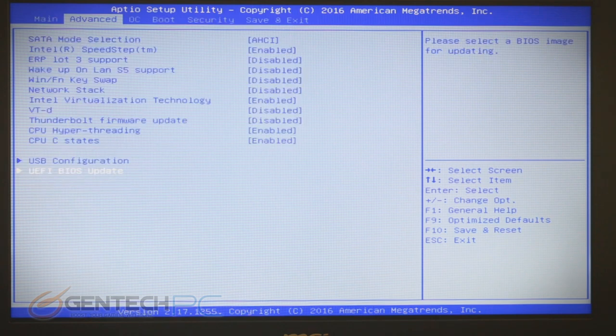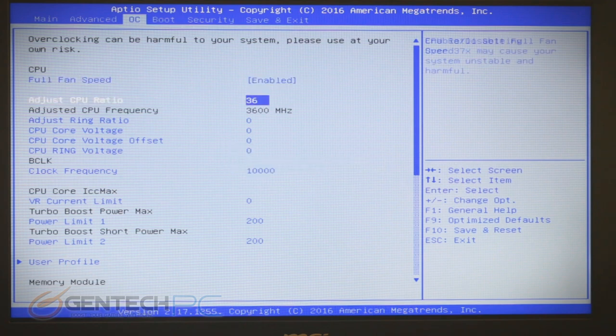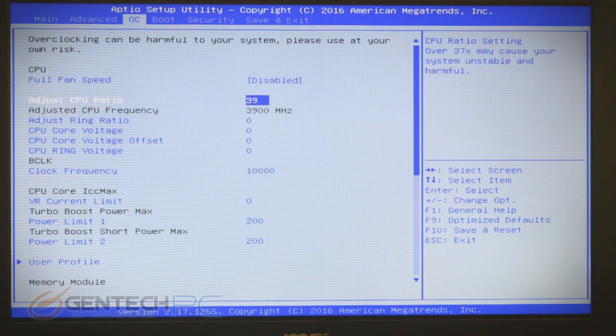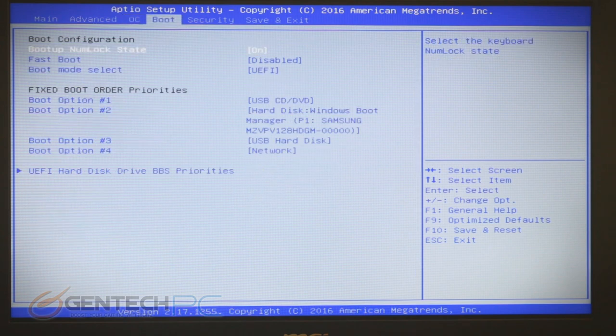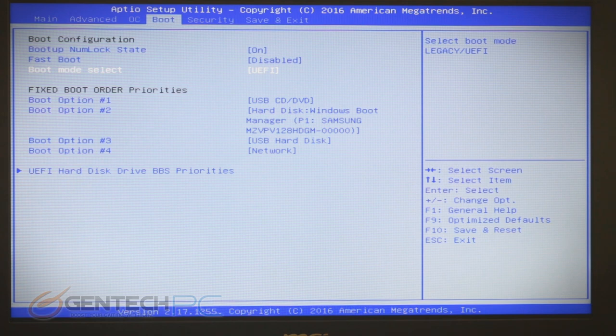The next tab is going to be the one that's really interesting. We have an overclocking tab here where we can change a lot of the CPU options. This is something you would normally see in a high-end desktop motherboard, so it's very unusual to see this inside of a laptop BIOS. This lets you do full pre-OS overclocking, which means it's not dependent on software. So for those who'd like to run Linux and other unsupported operating systems, you don't have to worry about the manufacturer's software to do your overclocking.